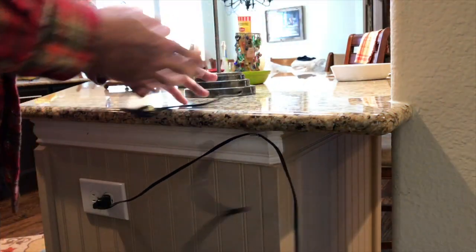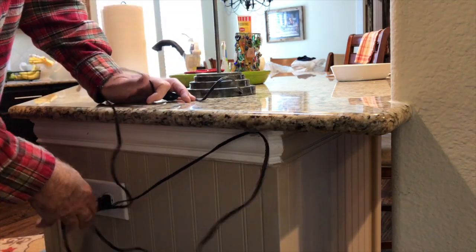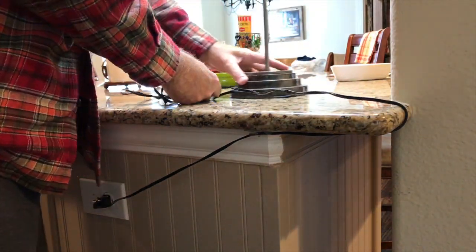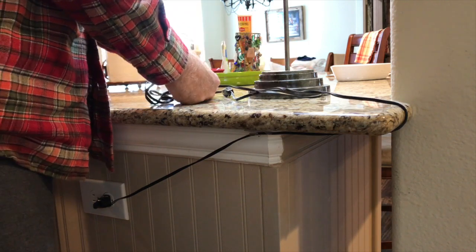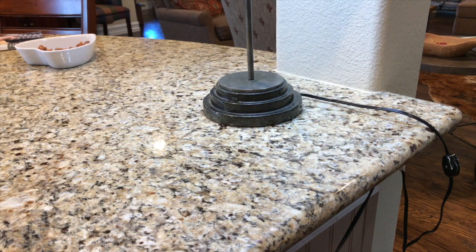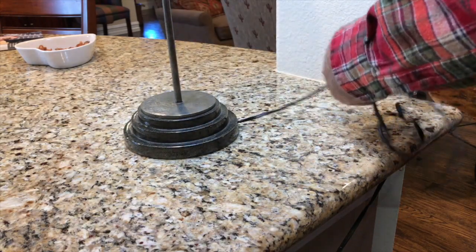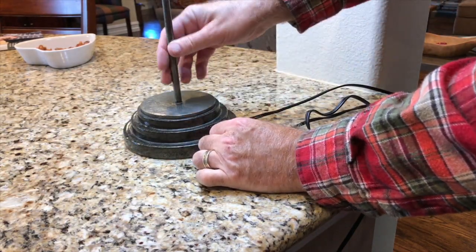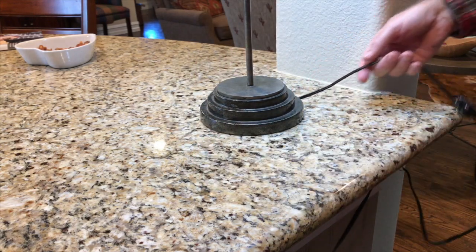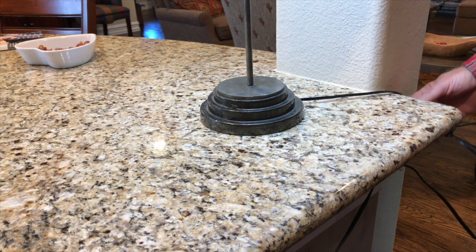I've untangled the cord. The first thing I want to do is determine how long we want this cord to be and cut out all the extra. We plug it in, put it through our loop, up here — the lamp is usually pushed over here, so we'll give about six to ten inches of extra length. We'll make the switch somewhere in the first three or four inches so it's right on the counter, not underneath it.